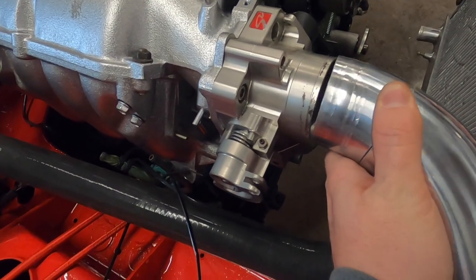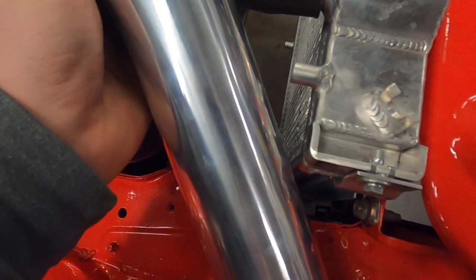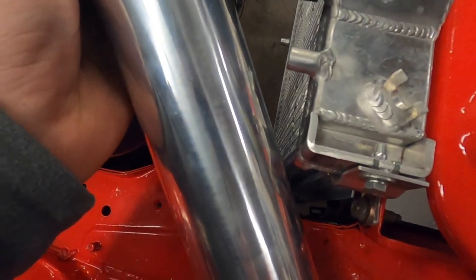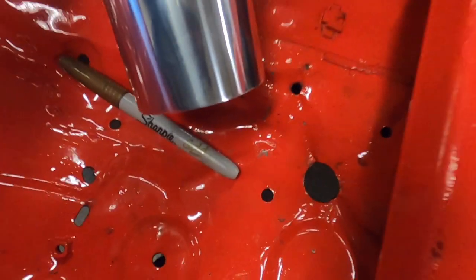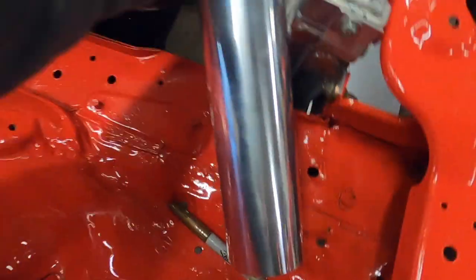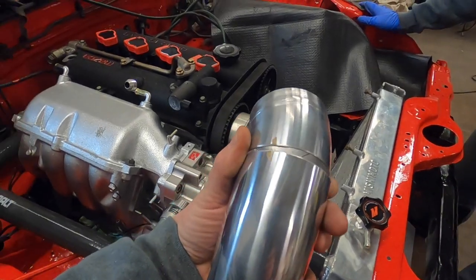I cut this to 18 degrees and already fit-marked it. It comes as close to the radiator as I'm comfortable with. Then we're going to cut this off later and do an almost 90-degree turn down into the fender well — and that'll really be it. It'll be a pretty short little intake. So I'm going to weld that together and at least put some tacks on it.